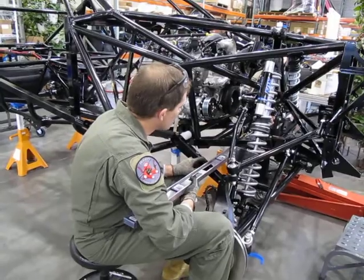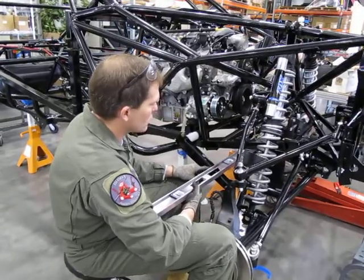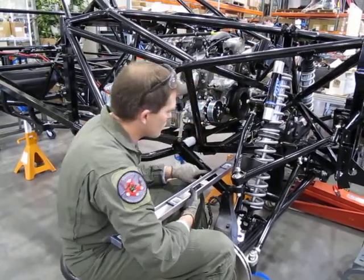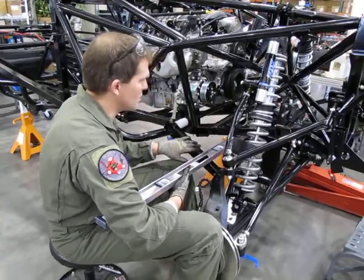In this case, basically what you look at is, are you about to the top of the third hole, Mike? Yeah. Okay, so we're 1, 2, 3 holes down. You're looking across to see the same distance to the top of the hole on each side, so about 1/4 of an inch, and then you look and see whether it is level, and you can see that the level is level, and that means that these are indexed the same.